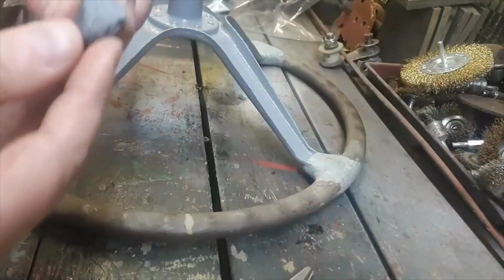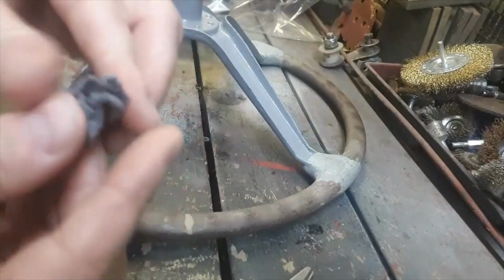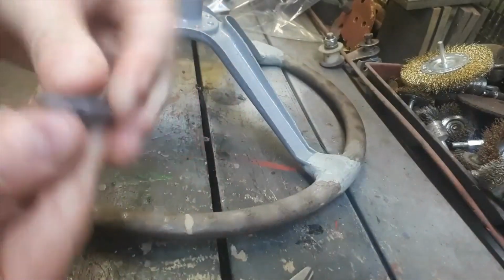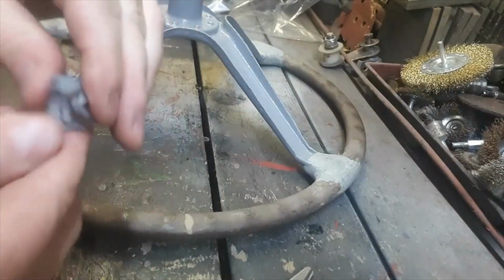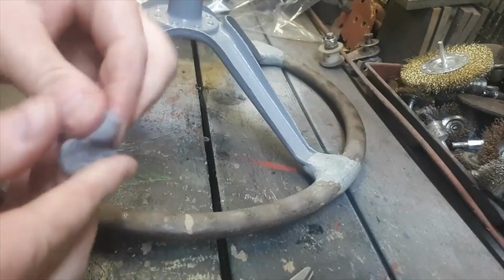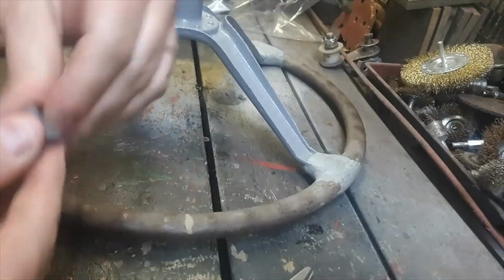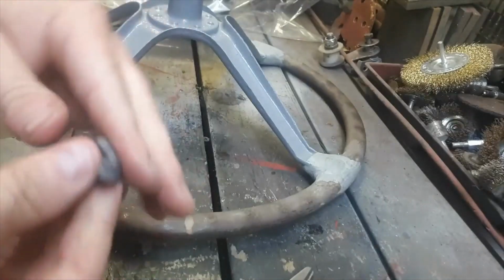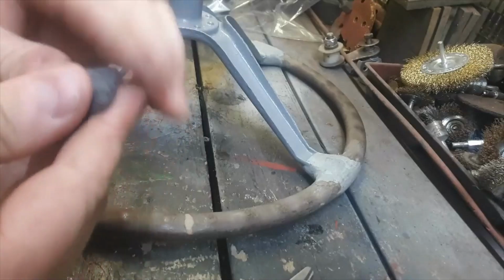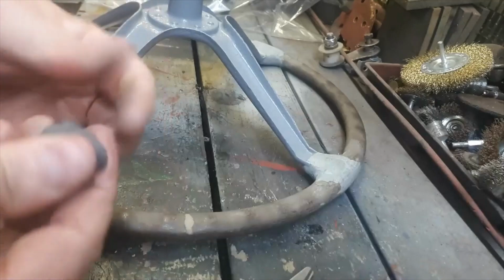And then just literally, you see all the different colours, you've got to push it and mix it around. Try and work pretty quick. Try and, you know, move it around pretty quick, because it gives you more time to work with it. Within 10 minutes this stuff goes off pretty hard, so it's more or less hard. As you can see, I'm working it pretty quick now. The colours all change into like a really deep dark colour. It's more or less done.